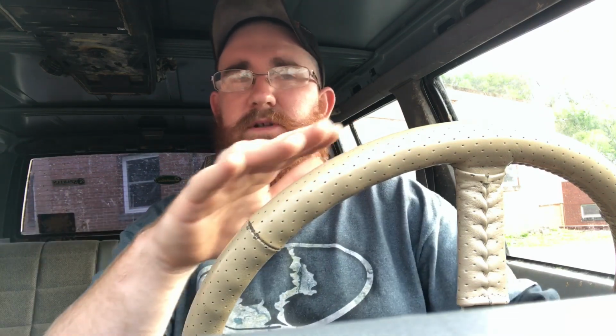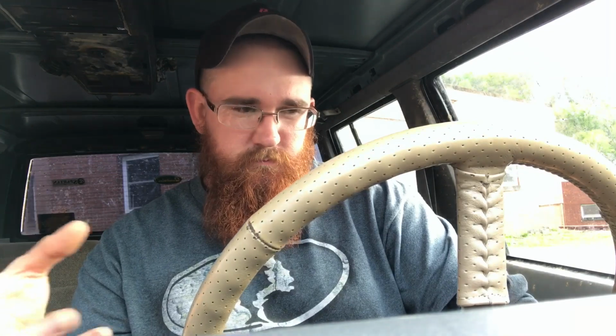Another thing, when you're crawling real slow, I went out and tried it again, and it did get a little hot, a little bit past the white line, like I was sitting in traffic, just crawling through the woods. But I wanted the heat to escape a little bit better out of the hood, because these are kind of like a boxy kind of deal, and there's no place for the heat to escape in these things. I didn't want to get the stupid spacers that lifted the hood up in the back. So, like I said, I just went and got E-vents and put it in there.